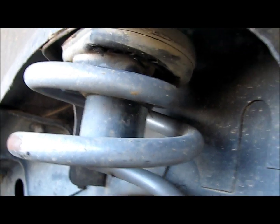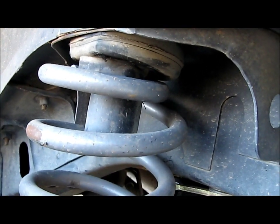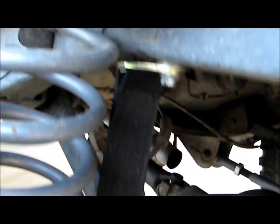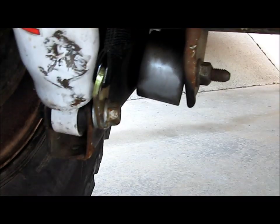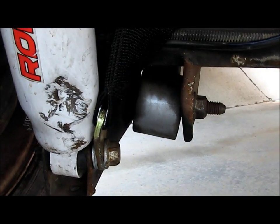So you just gotta experiment and, you know, pull up on something like this, just in a shopping center or whatever, flex it out to where you feel your max flex is, and then measure for your shocks and measure for your limit straps. And so you just measure from bolt hole to bolt hole. I went ahead and went to the shock mount. You measure that, and then you order the strap.